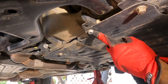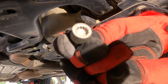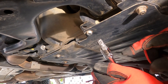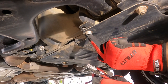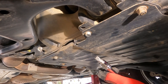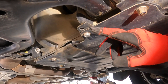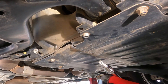So these bolts here — that's what it looks like. People think it's just a Torx, but it's not. It's called a triple square. If you put a Torx socket on it, you will at the very least damage the threads or the head where the socket goes in. At best you'll take it out fine, but you could end up having to manhandle it out — maybe getting lucky with vice grips, but there's a good chance you'll have to drill it anyway.